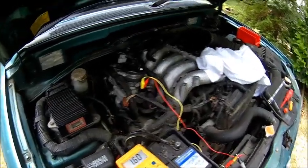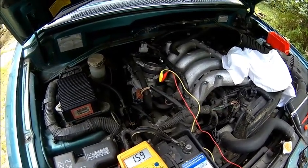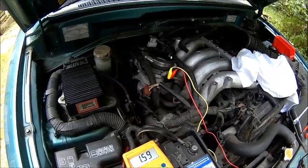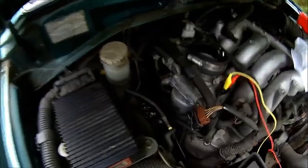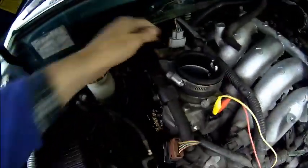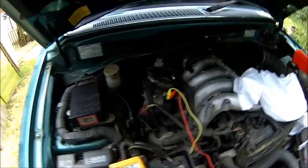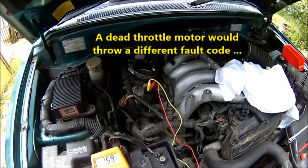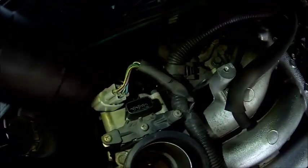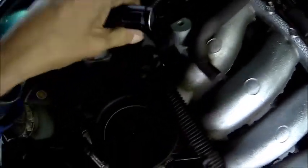There are further possibilities - mechanical. I'm not sure, except the motor has a problem - that's another story. The motor is electrically okay but doesn't do the full turn anymore. But from what I can see it's moving quite easily. There is still a possibility where the motor is - that's probably the motor here. Let's check that connection as well just in case. Because if the motor is electrically okay but doesn't move or has poor connection, it may eventually cause the same problem. Well, the motor connector looks good as well - wiring looks okay, there's nothing bad here.